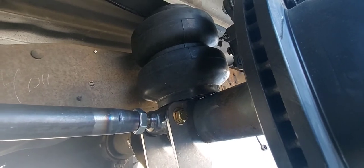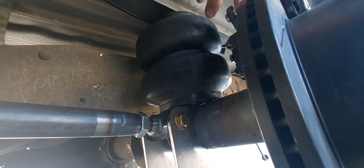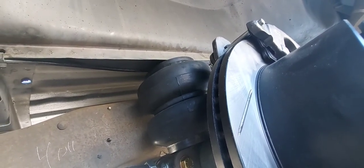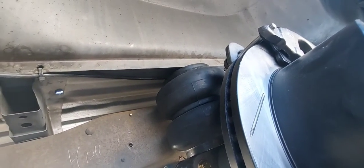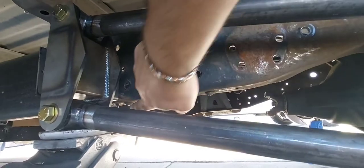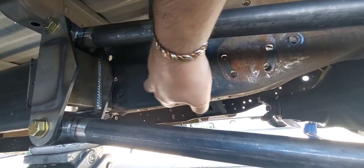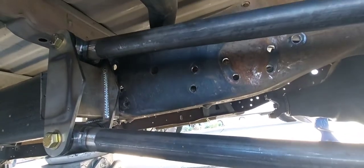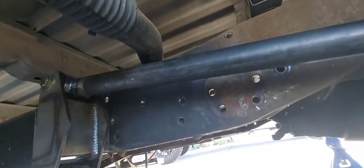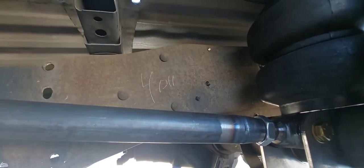When I go to notch everything, tires should be fine — the rims are no deeper than factory, although the inner wheel tubs will be pushed in and up to make a little more clearance for everything. I'm going to run a quarter-inch plate fish plate on the outside where it welds to the frame for extra strength. I'm also going to box the inside of the frame all the way back to the C-notch for extra strength and rigidity.